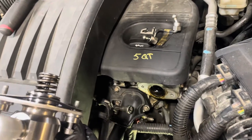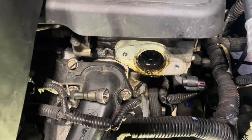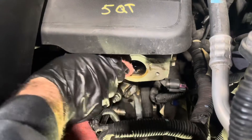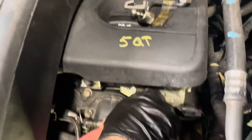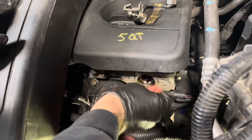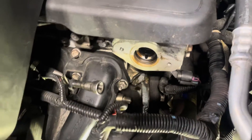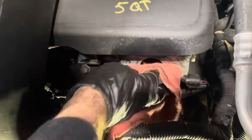Put that to the side. Make sure your new one comes with the new gasket. Before you guys put the new one in there, just wipe this off. Make sure you clean up the spot here so the new gasket seals on there properly — you don't want that leaking again. While you're at it, take your rag and clean up the inside too. Then take a little bit of brake cleaner and spray it just to make sure it's completely clean and doesn't have any oil residue.